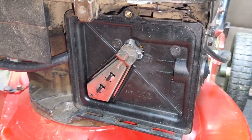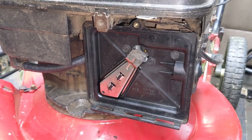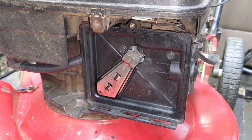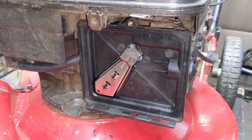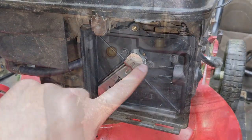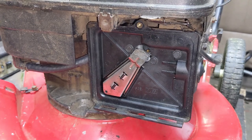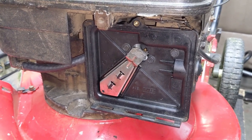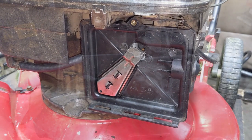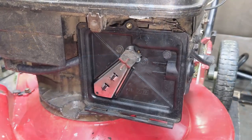As a little tech tip: if you install a single gasket, it may leak because it's going to be thin. One of the tricks is to take that gasket and soak it in water or gasoline before you install it — it will actually swell up a little bit. As you saw, the one on the carburetor was deformed; it had that little indentation of the primer line because it has swelled up due to a little bit of fuel and thickened up. Or if you don't have time to swell one, you can install two dry gaskets and it will normally work just as fine.